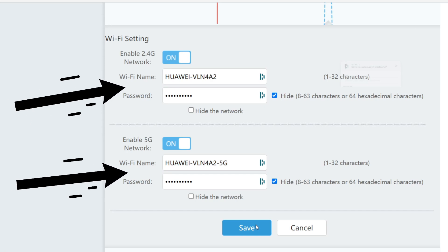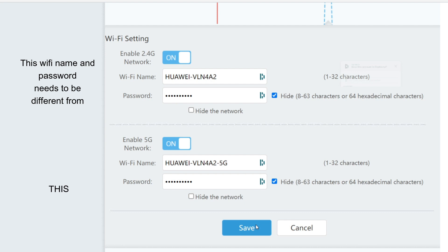If that doesn't work or your router doesn't have the option to turn off 5 gigahertz, another way to get around this is to rename the 5 gigahertz Wi-Fi and the 2.4 gigahertz Wi-Fi so that they're two different connections. For your own security you should be changing this anyway, so you can upgrade your security at the same time as fixing this issue. Make sure you name the 2.4 gigahertz Wi-Fi something different to the 5 gigahertz Wi-Fi and have a different password for each. That way when you connect your smart device you can just connect to the 2.4 gigahertz and this should solve your problem.